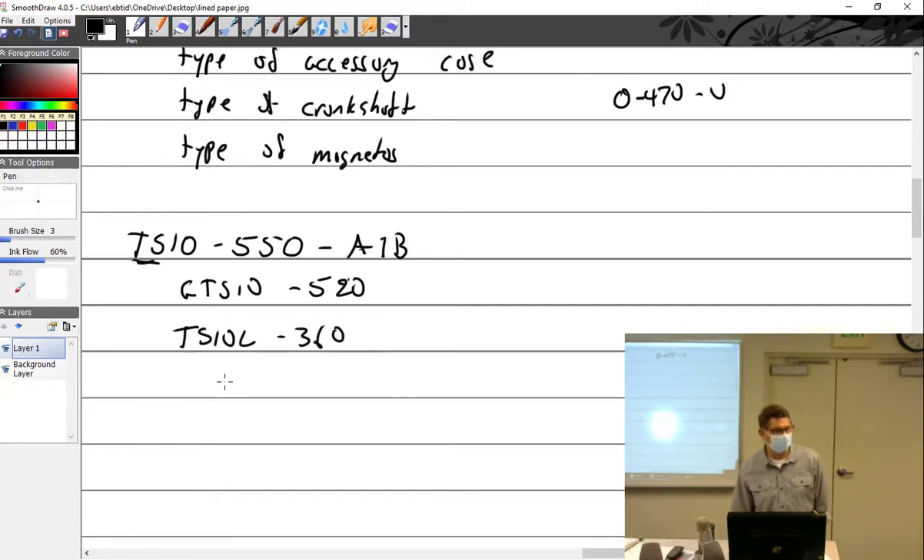If the cylinder contains 50 cubic inches of fluid at BDC and 10 cubic inches at TDC, the compression ratio is 50:10, or 5:1. Increasing compression ratio increases power and efficiency — so it's a good thing. But too much is a problem. Like cake: good in moderation, but too much causes trouble.